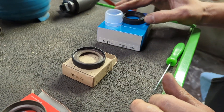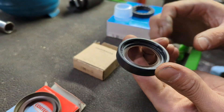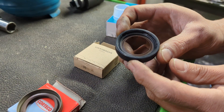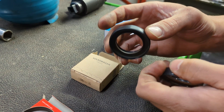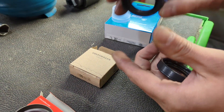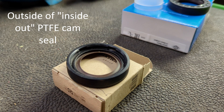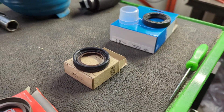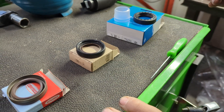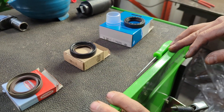For 2011 and newer cars, we have a different type of PTFE seal. This is what I call the inside-out PTFE seal, because the sealing lip faces towards the motor on the regular PTFE, whereas on the inside-out PTFE seal, the sealing lip faces outward. These are also really reliable, and if you don't need to mess with them, don't mess with them. Unless the seal is leaking, just leave it alone, because you're far more likely to cause a leak due to an installation error than to have a seal start leaking on its own.